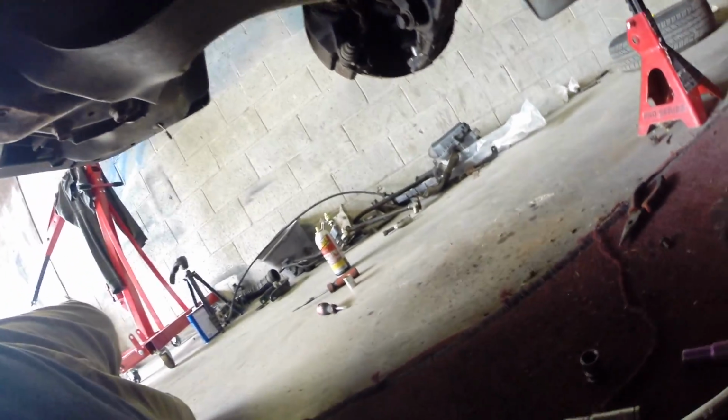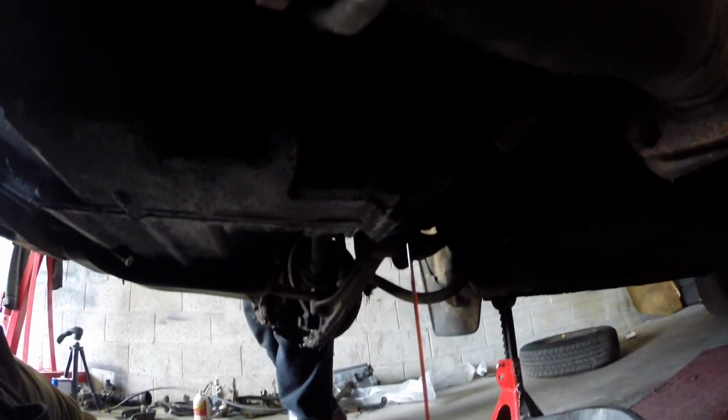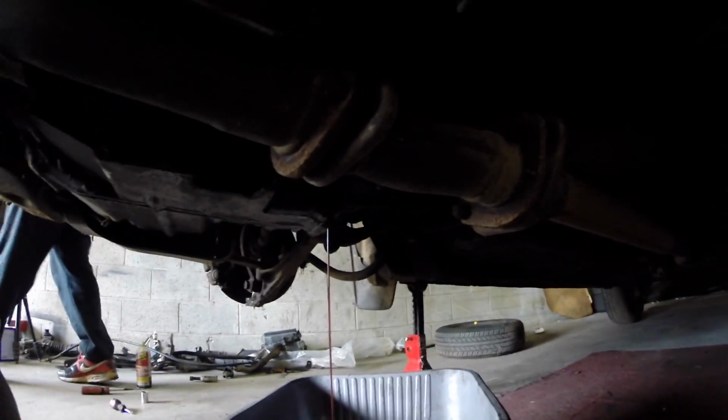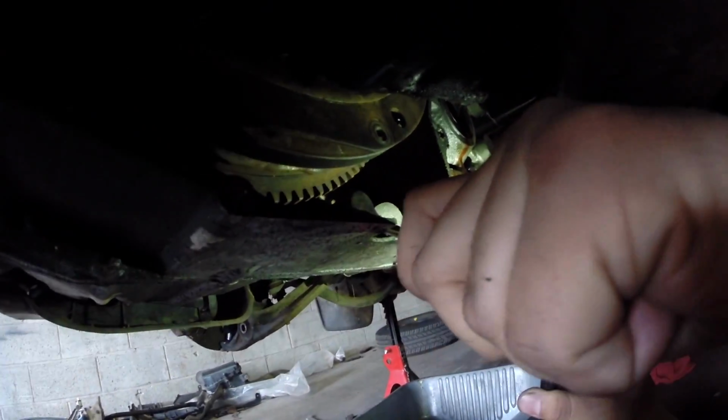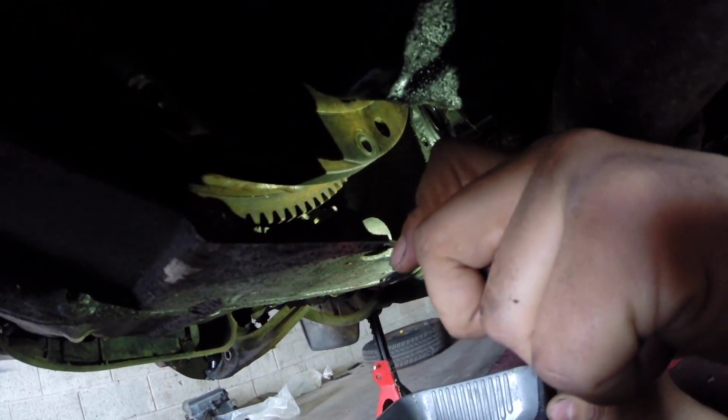I'm going to wiggle this thing here. Oh God, no, cup. Okay, yeah, when you pull the axles out or drain the transmission first, which I forgot to do, when you pull the axles out, it will start draining fluid. So now we can pull this axle out. Yay. So we have to remove the shifter cable. There's a little pin in here that we have to remove.